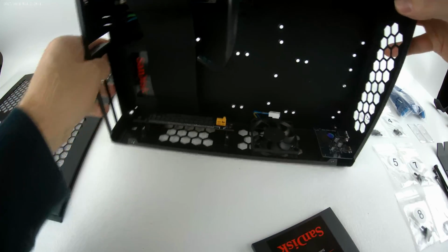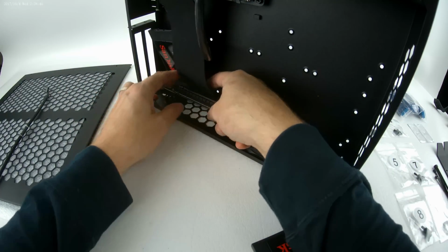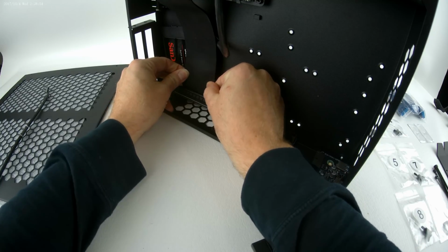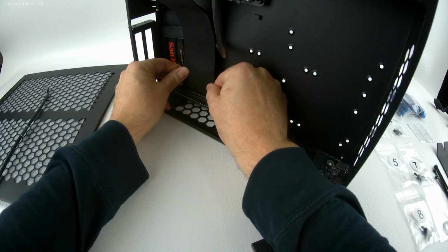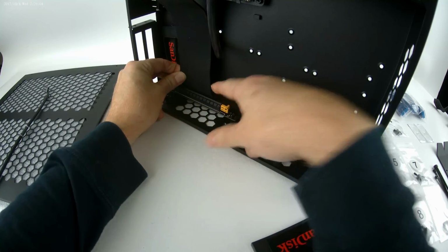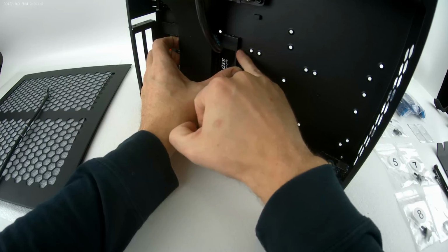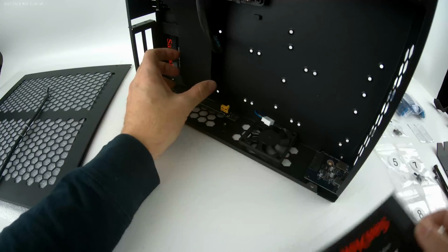If you look, let's angle this a little bit. If you look, this cable has pretty good flexibility. I don't like putting a lot of pressure on it, but these cables are pretty high quality. If you bend it back towards itself here, try not to push right against the plastic part, but push from above and get that curve good right there. What you'll be able to do is put the disc in, and it will fit. This hole needs to line up with these holes. So let's see them fit in.